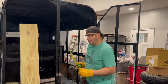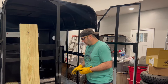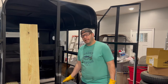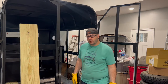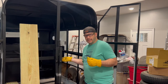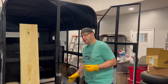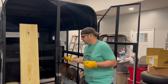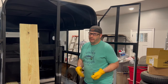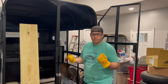First thing you want to do is measure the inside of your trailer to see what you've got. Now this floor when I removed it actually had no bolts in it. Most floors will have some carriage bolts. They decided not to put bolts in this one. What they had is a lip in the front towards the nose, and then angle iron — a 2-inch angle iron lip — that once they put the boards in, they welded in the back to hold everything in place. I'm going to reuse that welded part in the back because it's really sturdy and really new.